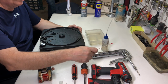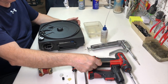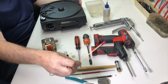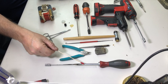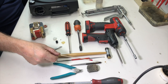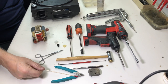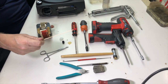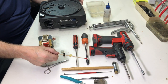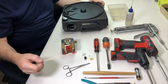We're going to use light oil, a grease gun filled with super lube, a quarter inch nut driver, a number two Phillips screwdriver, a long-shafted quarter inch nut driver, a hammer for staking the link, a punch for staking it in our block, cutters for cutting out the old link, a slotted screwdriver, and a magnetic quarter inch nut driver. Here are our tools along with the hemostats.